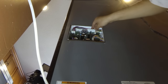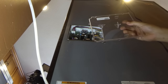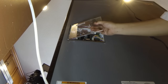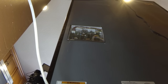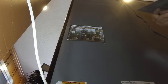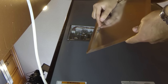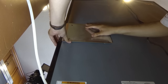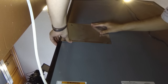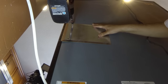Now we're ready to return the protective cover on the actual control. To do so, you're going to line up the tabs on this cover into the left hand side. Once they're inserted in their slots, go ahead and push down on the cover, just like so. Now we're ready to re-secure the actual steel cover for the control. Line up the panel — there is a tab on the other side that will be inserted into an opening on the right hand side. Once it's lined up, you can go ahead and return the four quarter inch screws.